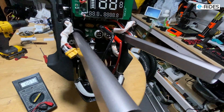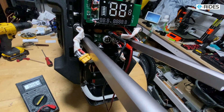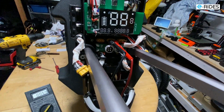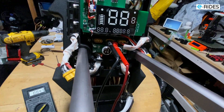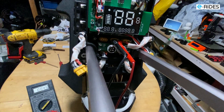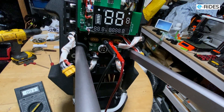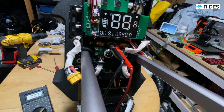So that is not very good actually. There's no backup pack or anything like that. So if any battery pack fails, then the wheel will have no power whatsoever. Not like the early EXN where there is a three-pack battery system — if one pack is disconnected, it will still work. Even if two packs are disconnected, it will still work, because each pack is 100 volts. Here we've got four packs and each pack is 33 volts. So basically there's no backup power on the master.